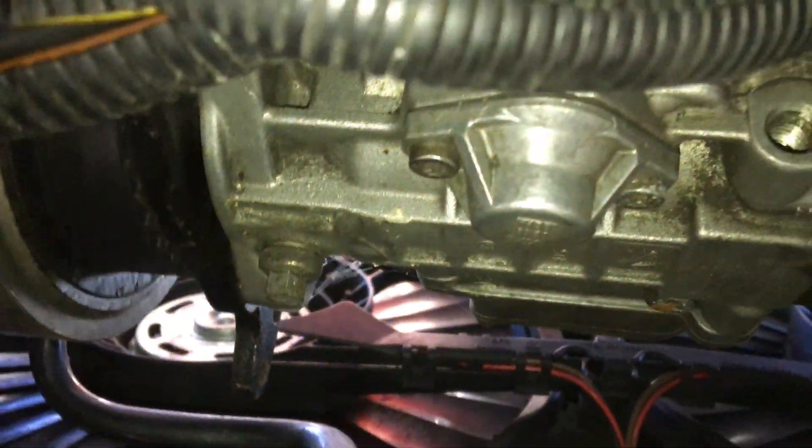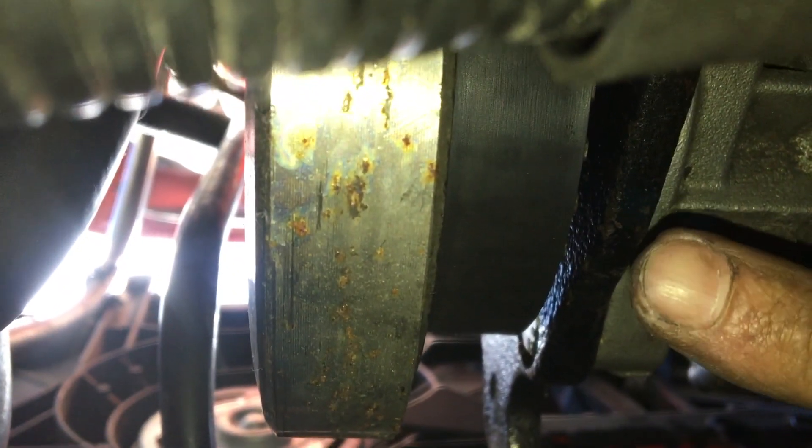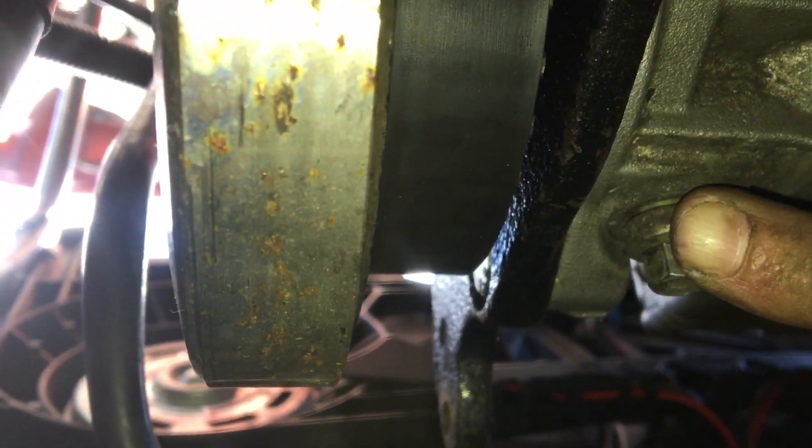Just a few seconds and it's all done. It's not going to focus, but that's right in the middle — 55. So that is how you time up your pump. I loosened this, rotated it until the DTI said 55, and I'll tighten that again. Now I need to go to the top of the engine, re-torque the bolt on the cam pulley, then come back down here, put the little space saver in, and fire it up to see if it starts first time with no smoke.